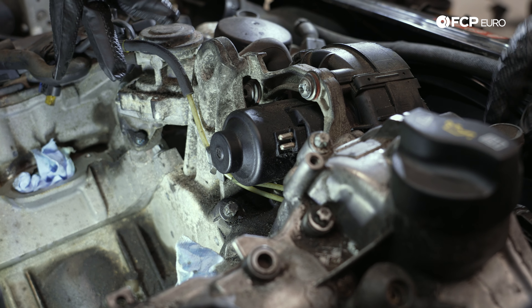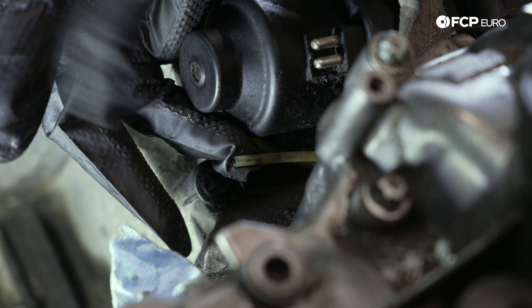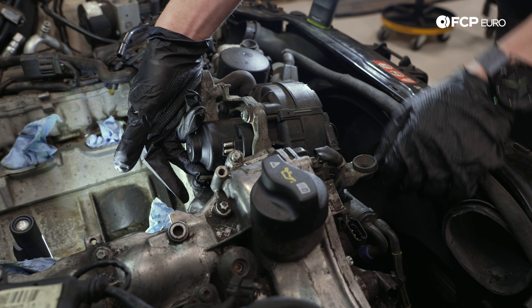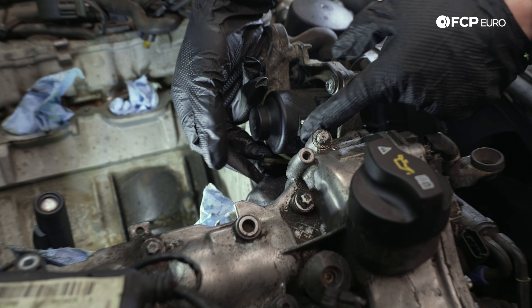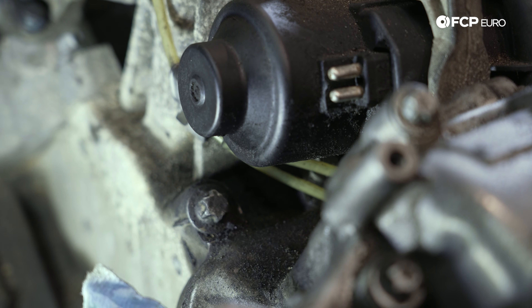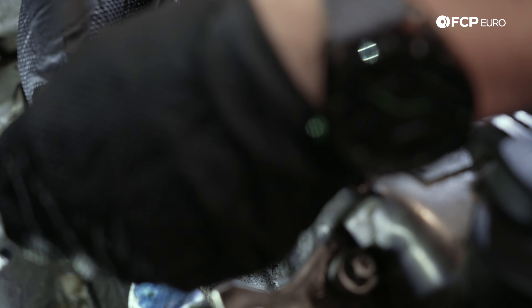If your vacuum lines are a little brittle — particularly around the secondary air pump — the plastic nipple may break off, as ours did. The actual vacuum hose going up into the manifold from the secondary air pump check valve was dry-rotted. What we did was cut a slit down the remaining portion of rubber hose to take it off that last bit of nylon tubing. Then just take some vacuum line and slide it directly onto the end of that nylon hose to connect it to the new intake manifold.